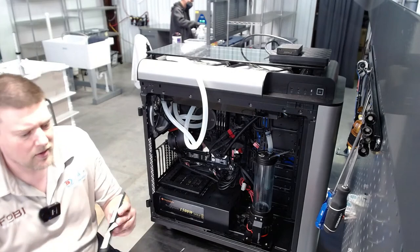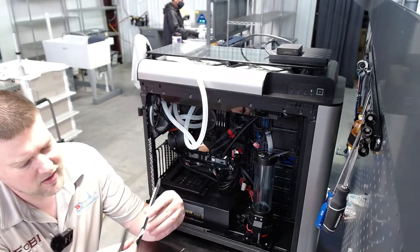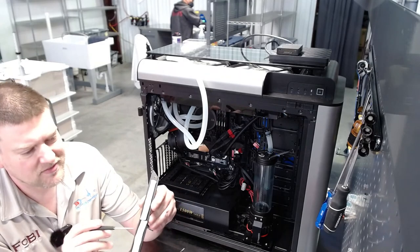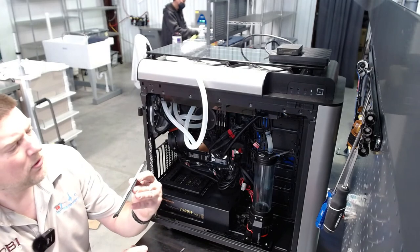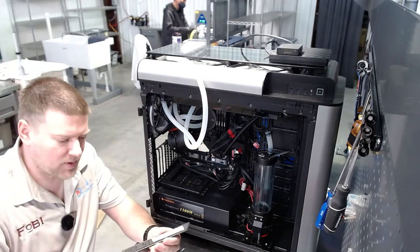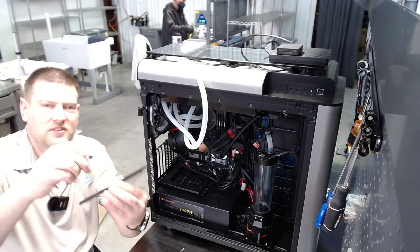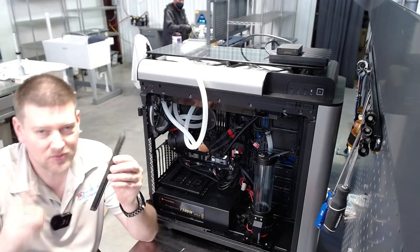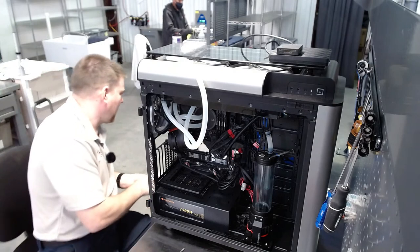Okay, so judging by the thermal pads that came with the computer case, that's these ones, I had pretty good squish, but we're gonna change all that out and instead we're gonna use the K5 Pro. So we can just go ahead and peel these off. When they start separating, like pulling apart, that's when you know they've gotten some heat damage, time to get rid of them.